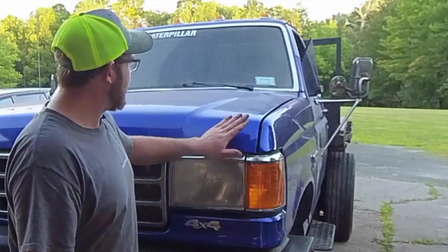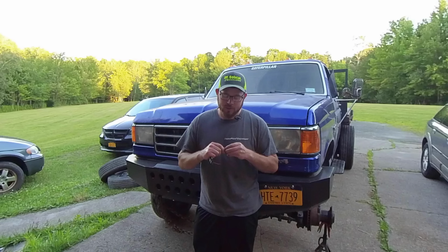So obviously I've made some progress off camera here. Not gonna lie to you guys, I did take it for a little test drive. So I got the TCM all wired up. Jason hooked into it, and then he remotely accessed my computer. The Cat and the Allison weren't talking to each other, which he said was no surprise, because originally we were gonna use the J1939 data link because it's kind of the easiest route to go. They just kind of talk to each other and tell each other what they need to know.